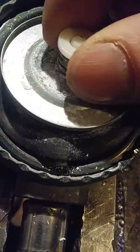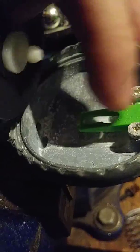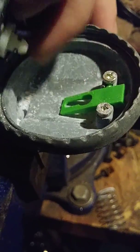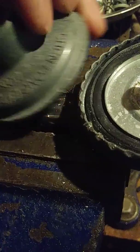This is how you can get a fire under your barbecue — there's sort of a gasket diaphragm and that's where it's ripped. See that little plastic thing right there? When gas flows through, it pushes that up like a fulcrum, moving it up and down. When this diaphragm is leaking because it's ripped, you'd smell it out of this little breathing hole. The hole allows air to move in and out to flow with that spring in place.